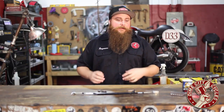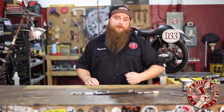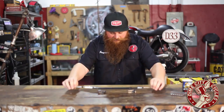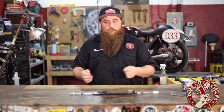Hey guys, I'm James and welcome to the Dime City Garage. Today I'm genuinely excited to introduce an all-new Dime City Originals product. It helps correct a rather sketchy problem and allows for easier installation and modification of foot controls, primarily the rear brake and its associated mechanicals. Here we have the all-new Dime City Originals rear brake cable conversion kit. This kit allows you to retrofit a cable in place of the stiff linkage rod between the rear brake and your rear brake actuator.